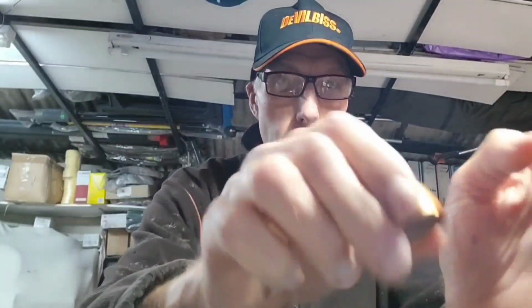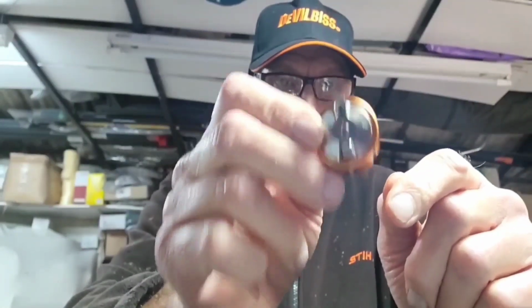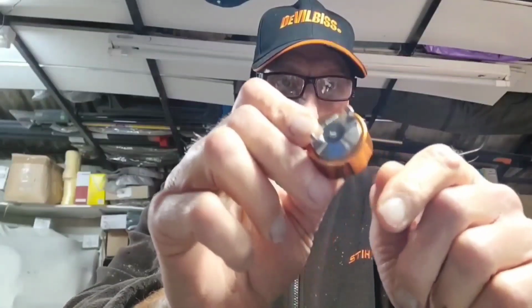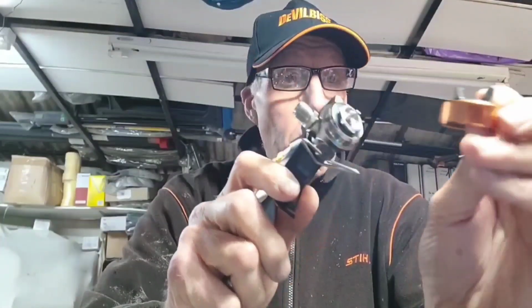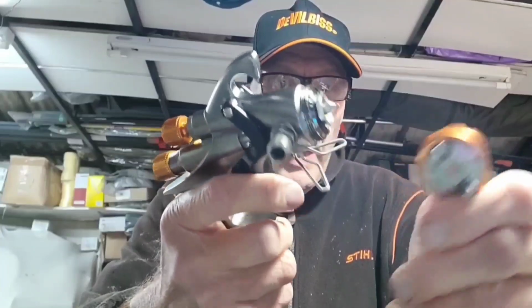This one, the R, the one that we saw just now, is your best bet if you want an all-round gun. It's supposed to use about 6.4 CFM as opposed to this one, which is about 7.4 CFM. That's at 2 bar recommended pressure. So this one actually uses less air and it's more of a universal cap. It's a little bit slower than this one, but it's a good universal gun. As I say, 1.4. If you're looking to buy one gun only, I would suggest the R, because by far it's the most universal. If you're not silly like me buying loads of spray guns, that would be the one I would recommend.